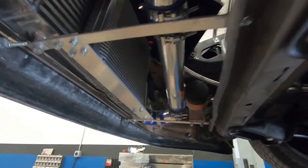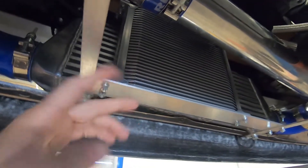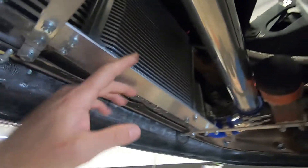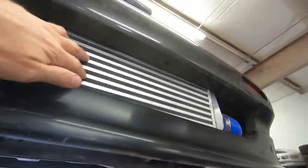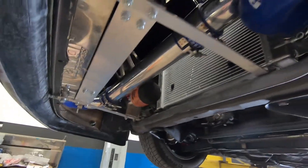As you can see underneath here, we have all this area where the air can escape when going down the highway. I do have an oil cooler mounted right behind the intercooler, so the incoming air will come across the oil cooler and help aid engine cooling. We've got to get this bottom piece covered — at least from this point here to this point here — so the incoming air has no choice but to go through the front intercooler up to where the radiator is.